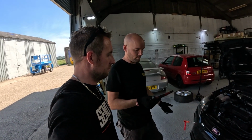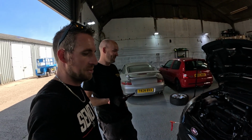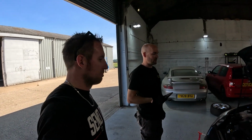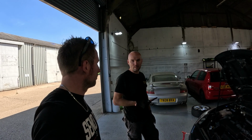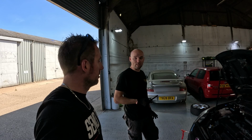I mean, I haven't got 2 kilos and I'm going to touch it. No, exactly. There's no point wasting any time trying to manage out 2 kilos. That's pretty much bang on, isn't it? Yeah. Pretty much the best we're going to get anyway. We're as aggressive as we can on it, so the camber's maxed out. Obviously, we've got no adjustment on the rear end at all, although the camber is really quite good.